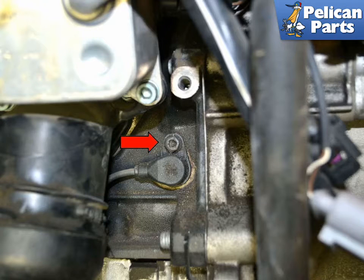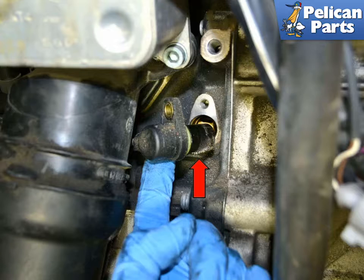The sensor is held in place by a 5mm Allen bolt. Make sure you clean the head and area as you do not want to strip this bolt (red arrow). Remove the bolt and the sensor from the engine. The sensor is actually a magnet, so finding small metal dust on it is not unusual (red arrow). If you find anything larger, it is cause for serious concern.